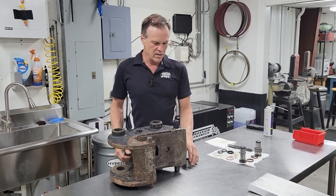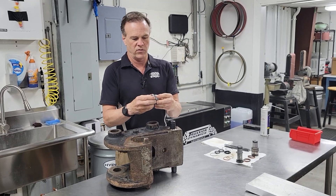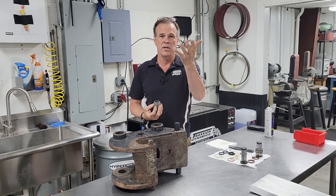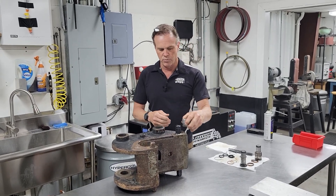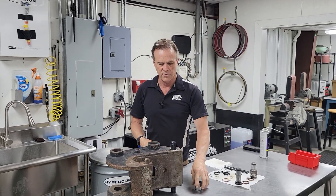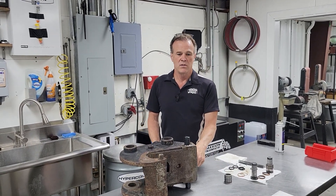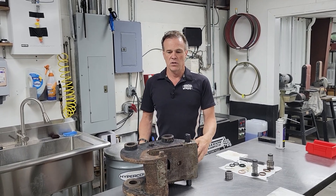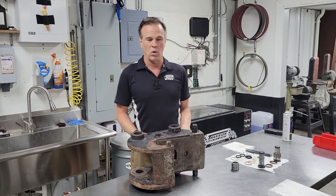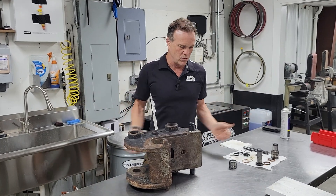I did have to use quite a bit of force to get the external seal here to pop up. It's got to pass through that circlip groove. You've got to be able to pry it — rock it, walk it, twist it — and eventually it'll pop out. There will still be oil down in this cavity, so at that point turn it over and let it pour into a cup or a bowl to get about 95% of the oil out, so you're not oozing oil all over your workbench.